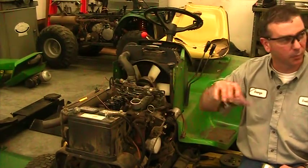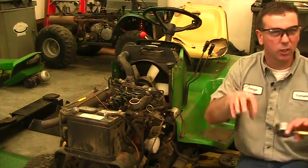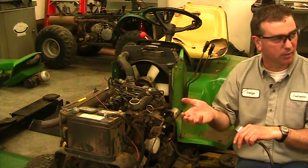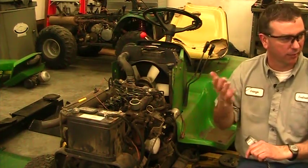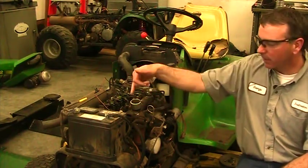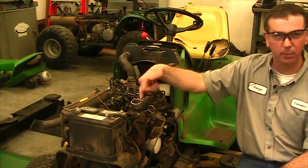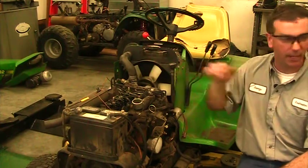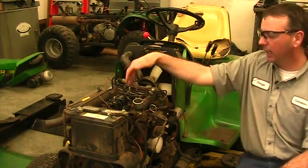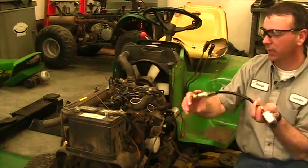I've disabled the fuel system, and I've also opened up the other glow plug holes so that while cranking I don't have that extra compression slowing me down — it's like pulling all the spark plugs out when doing a compression test on a gasoline engine, removing resistance so the engine cranks freely. We also pulled off the air cleaner, removing any restriction from a dirty air filter, so now we have a wide open intake manifold letting the maximum amount of air in.